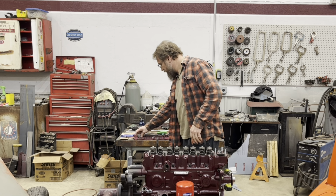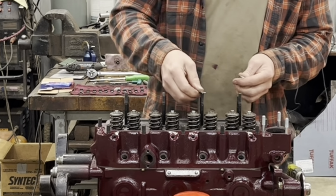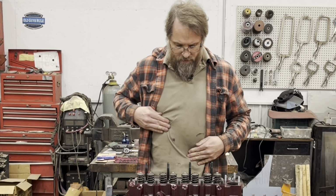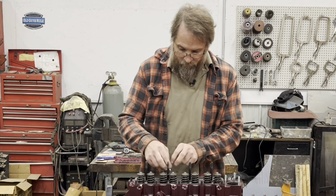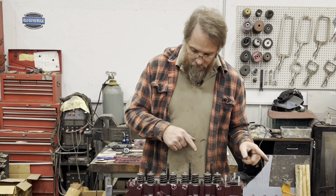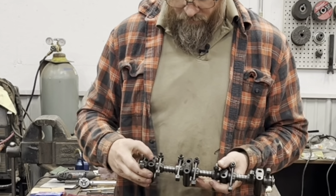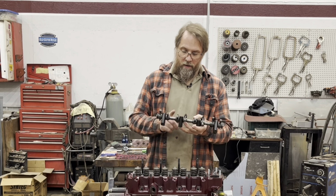And of course, we got our spacers that we ordered to get all the valve train where we want it, and the little shims. And you guys can argue in the comment sections about whether this actually needs to be on there, but I put them on every motor I build. The factory added them in like '65 and never took them off. They had good reason for it, because it does put some slight tension on the shaft, keeping it from rotating and working. And I guess that's what this screw is supposed to be for, but it's not quite as effective as it needed to be, and this just helps reduce wear on the shaft.